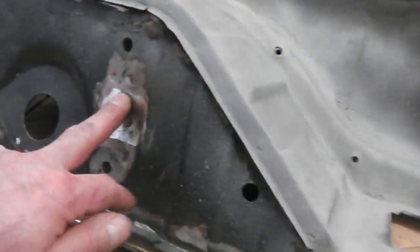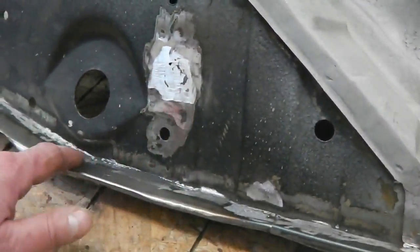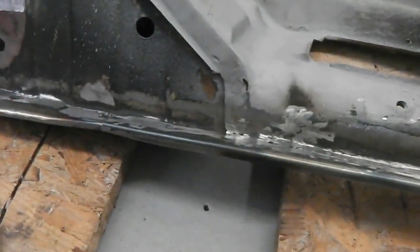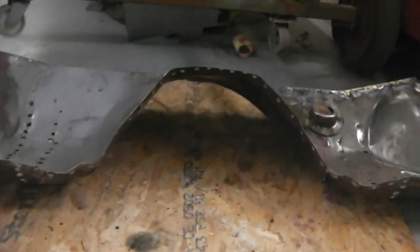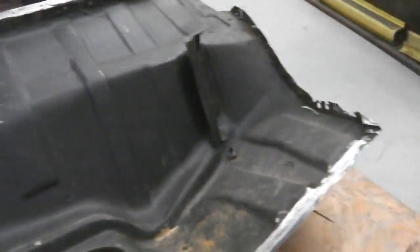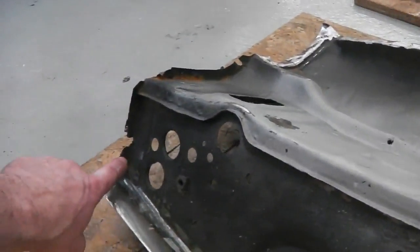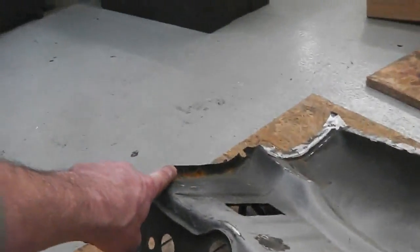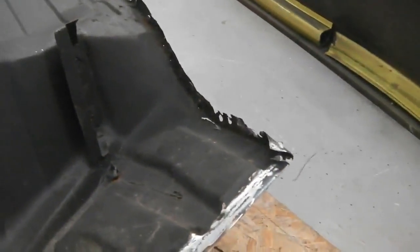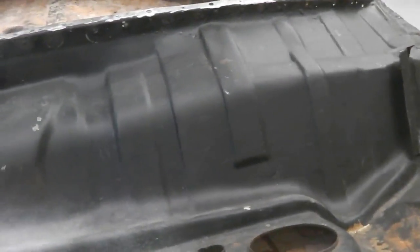Okay, so as I said, automatic conversion, so remove that clutch plate hole, blank it out. I'm done down this edge for this. That'll sit nicely on the top of our prepared lower bulkhead, which you saw in part 7. And really just going to keep on going on at this. I shall make a template for this now. I'm going to do these edges first. Once all the edges are done, in fact there's only really 3 operations, one vertical edge to repair there, a curved edge, then one continuous curved edge. It'd be nice to get one piece of metal in that. So it's welded out again, a bit more grinding, polishing, cleaning, cutting, then we'll shot blast it all and just keep on working at it.